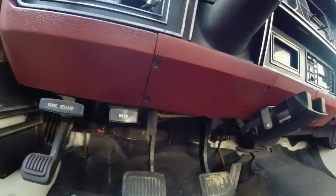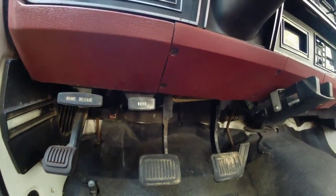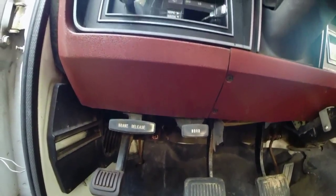I don't think it's going to influence anything strength-wise. There's plenty of material there to hold that and hold that master cylinder. The clutch really doesn't push down that hard. I just put two of the four 7/16ths bolts in it. The brace is against the double part of that wall up there, so it's not going anywhere. If I can break even one 7/16ths bolt with my foot, that says something about the hardware quality — but I don't think I can. From a liability standpoint, I think the factory just wants plenty of bolts in it, because they always get lawsuits if anything falls out. I'm confident I tightened them up and it's not going anywhere — it's against the firewall, so it really can't push out anyway.